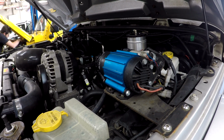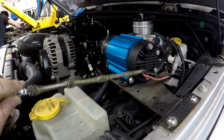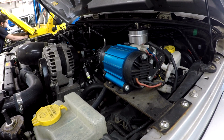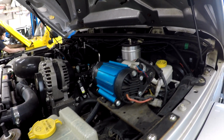Maybe that's not something you see in your neck of the woods, but it's something we see here. I've seen these wires get to the point that they short out and catch on fire on these compressors when you try to run them. And we like to mount these compressors under the seat for that reason.